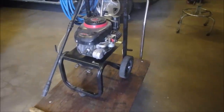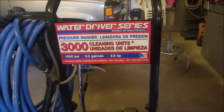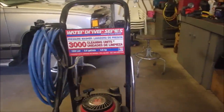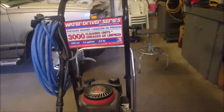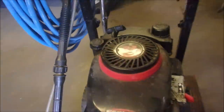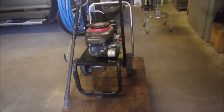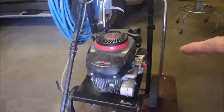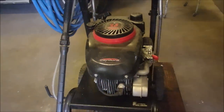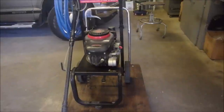Hello my friends. Well, what have we got here? Water driver — 3,000, 1,500 PSI, 2 gallons per minute. That's a small engine, probably a 4 horsepower engine — 3.8. Tecumseh, with a vertical drive pump. This looks like a lawnmower engine, but it isn't, because it'll have a cast iron flywheel instead of the blade on the mower being the flywheel.